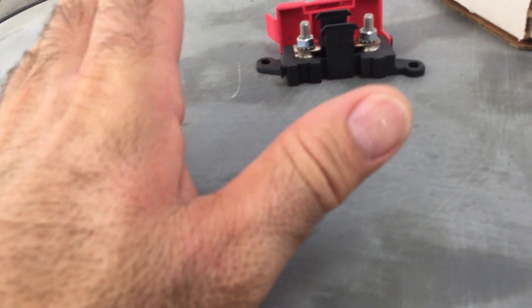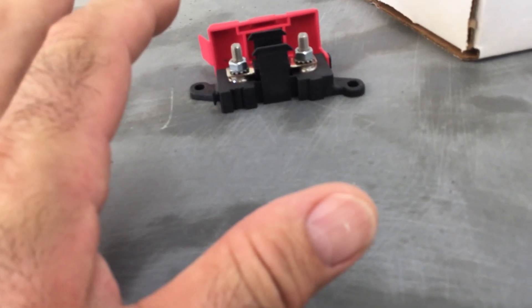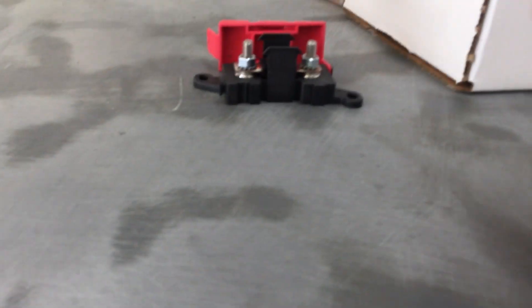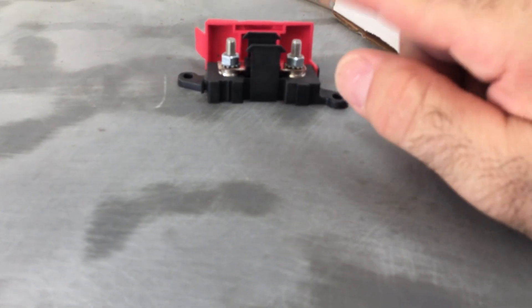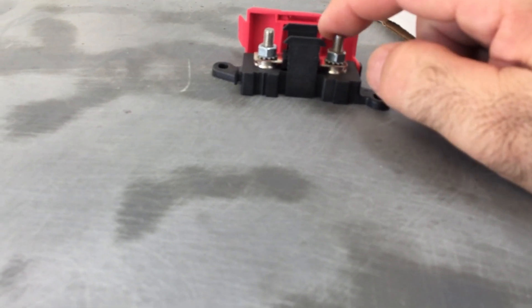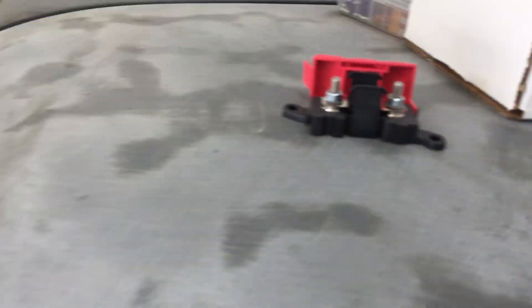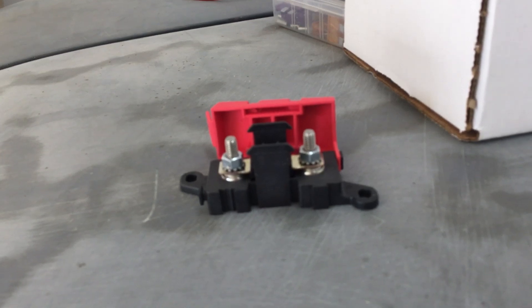The whole intent of the 200-amp fuse is not necessarily to protect the smaller wiring - it's to protect against a massive short in the battery cable, protecting everything on the opposite side. Similarly, if there's a massive short on the alternator side cable, it should blow and protect. I'm also going to put fusible links on the wire going to the constant power for the computer and any other accessories. I need to figure out a good location for the fuse block.